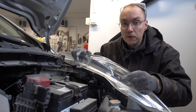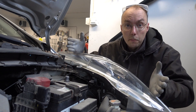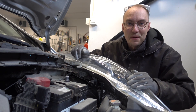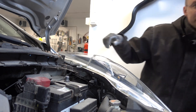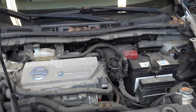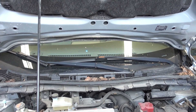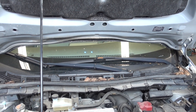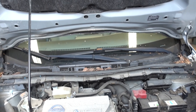I reconnected the battery and reinstalled the fuse. Before I reassemble the whole interior, I just want to hook it up and test it and know for sure that the new charger is working before putting in the massive amounts of interior that need to be removed for this job. I'll connect this and we'll do a charge test. I'm gonna plug in an EVSE and we will see how it performs - it's charging! Will it stop after five seconds? Yay, it won't stop! Hooray! Now I can bleed the coolant system before we get too much air in it.